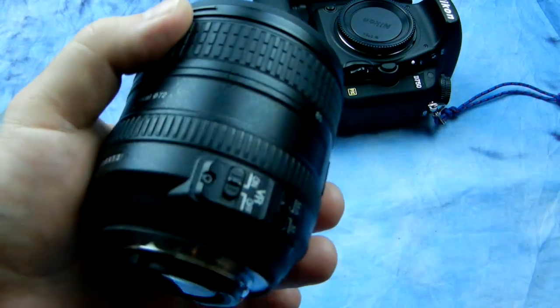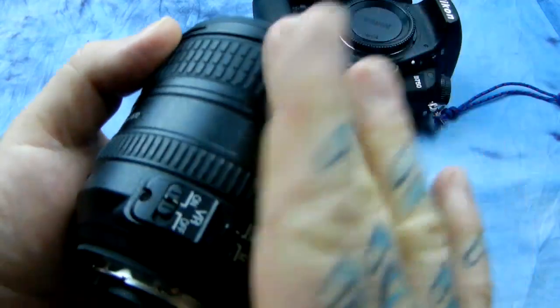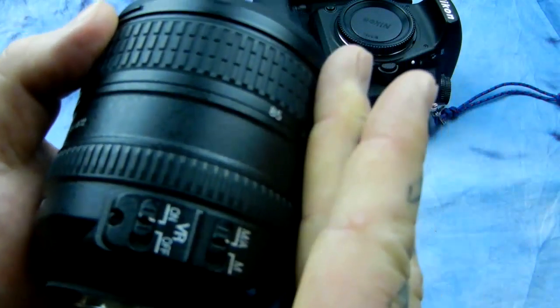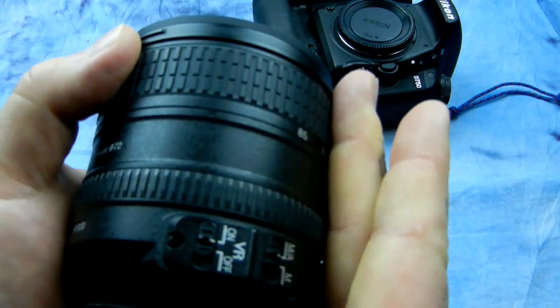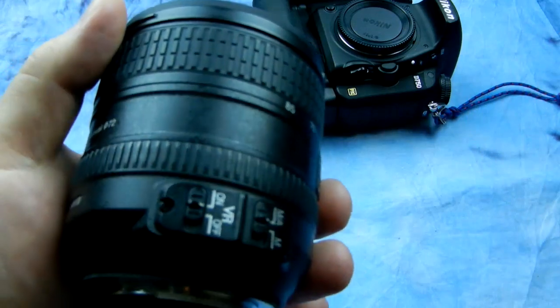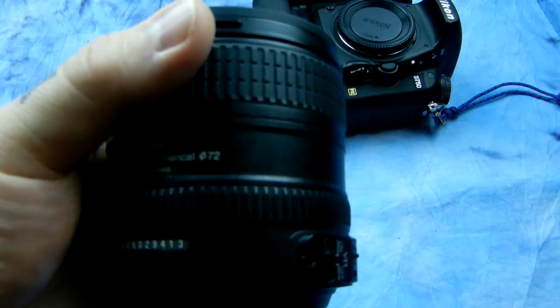This is a common issue on a drop. Check for drop marks — the most prominent ones will usually be on the edge, but sometimes they'll smack on the side of the lens. You won't notice it because it impacts the rubber on either the zoom or the focus ring, and you won't realize the lens has had a bad drop and one of the elements is askew internally.